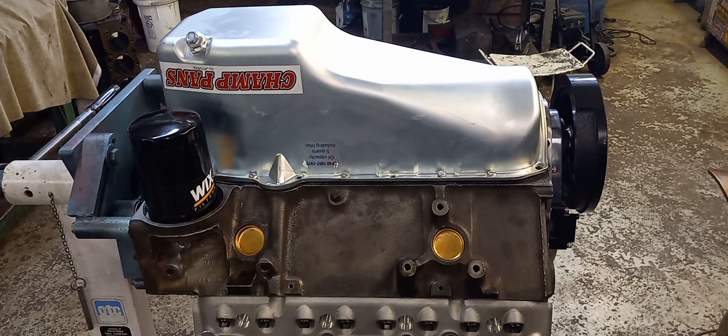There's probably not going to be a whole lot more to this video. I'm going to do the roller rocker arm geometry on this — I've done a fair amount of these engines with this size cam, these rods, pistons, and heads, so I kind of know what push rod I need. But before I order it I will go through and check it. Piston-to-valve clearance should be no problem with this cam. I'll maybe make a video on how I do that, but it's pretty straightforward stuff. Thank you for watching.